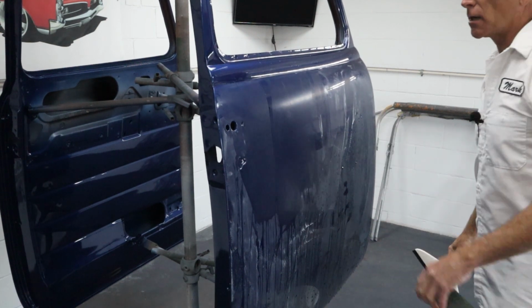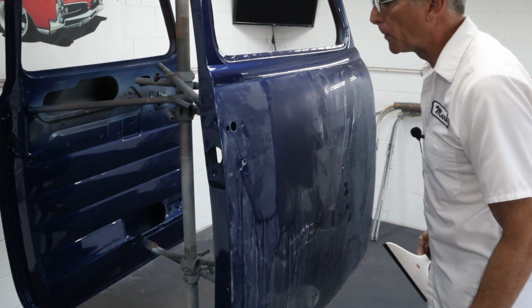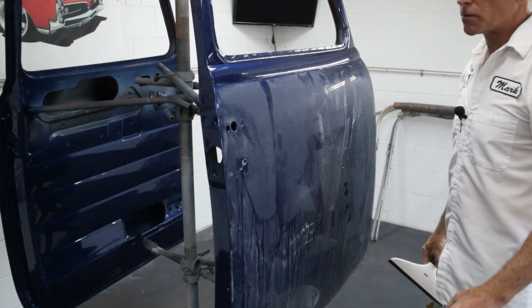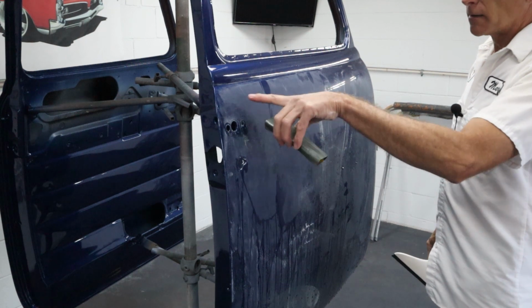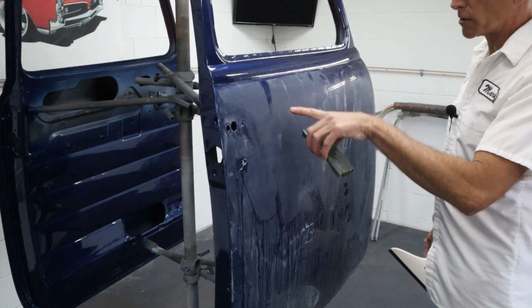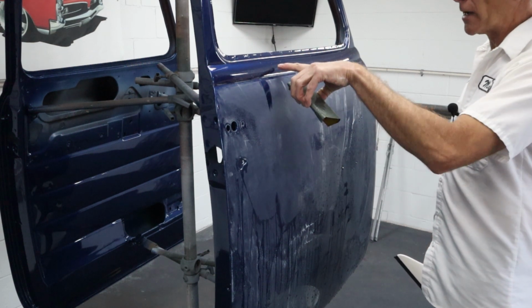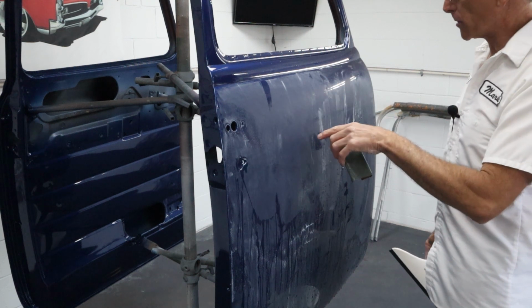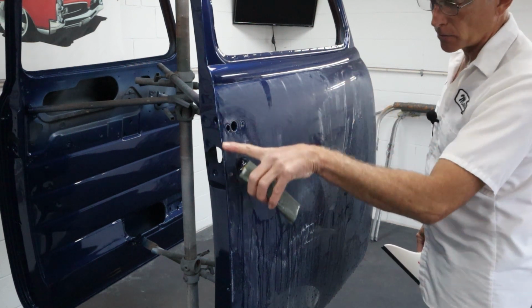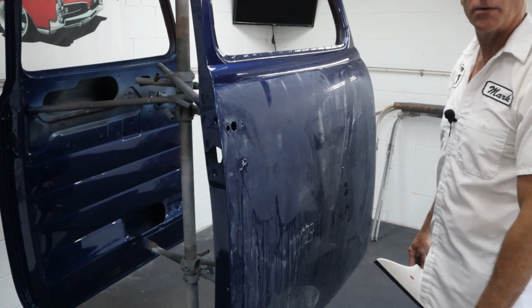And so we just squeegee it off. Just like that. As soon as it dries, I can tell. See right there? There's no orange peel in there. So we're good to go. We're ready to polish, and I could get the DA up here, no problem, and not worry about bouncing off this body line or screwing something up. So I'm going to go ahead and do this. I'm going to do along the edges, and then I'll bring you back and we'll get the DA going.